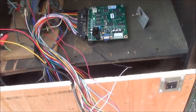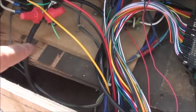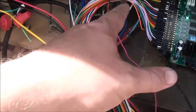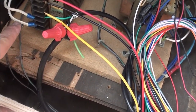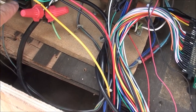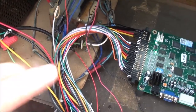I wired this up - I just follow the power. The power comes in from the plug, white and black is the power that's tapped into what was already here, goes into your ISO transformer through your line filter in the back, and you get 120 volts going into your switcher. I also tied the field ground into the ISO ground, so I need to tie the ground into the chassis to make sure it's grounded.